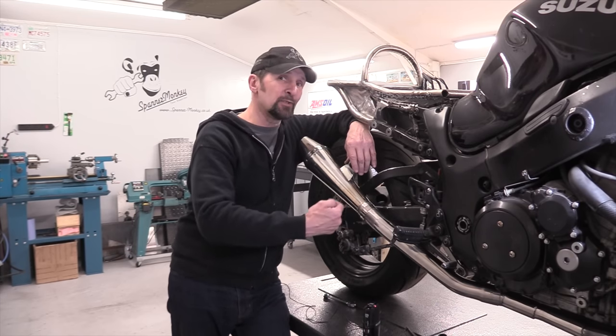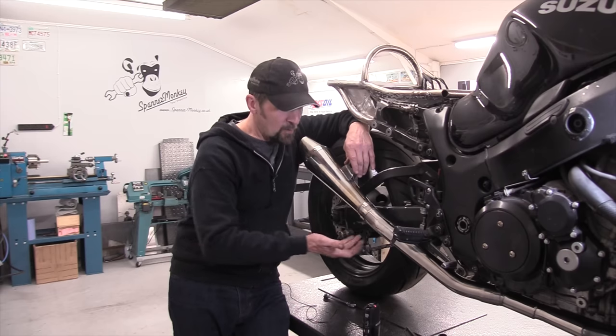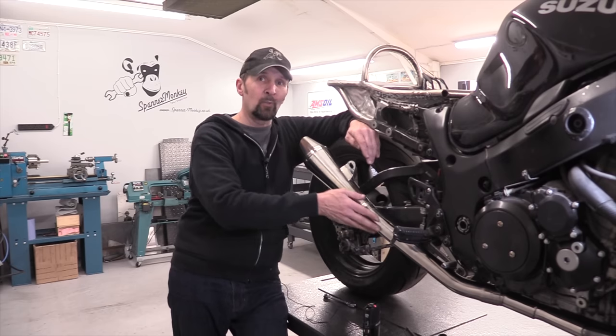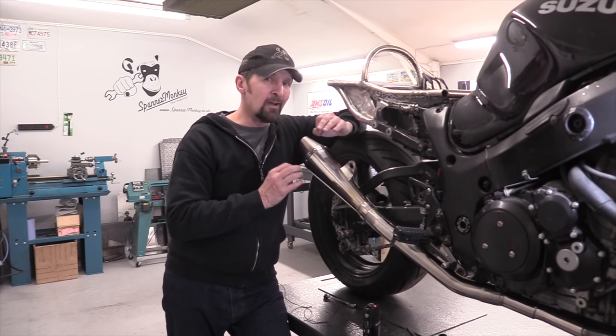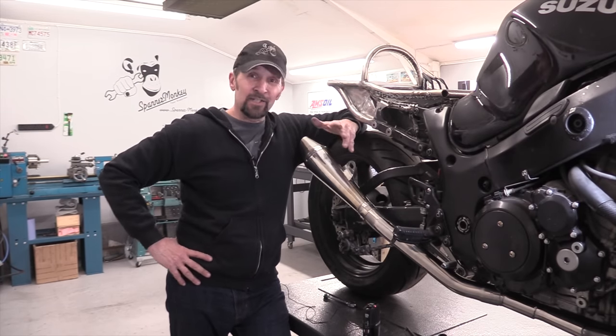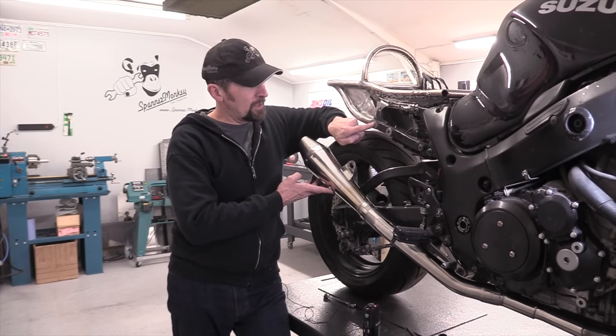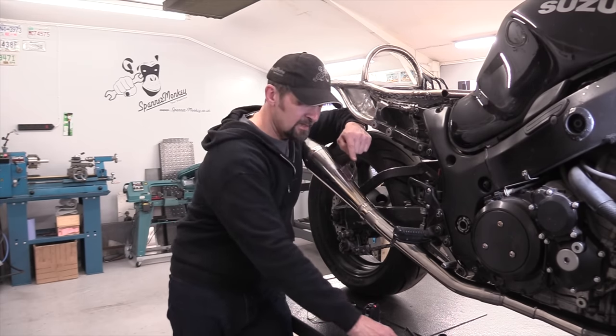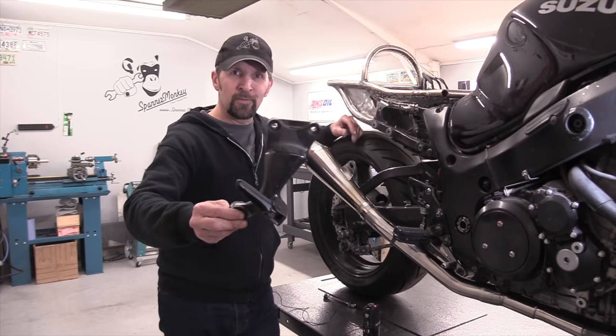So with a little bit of high temperature silicone in there, clamp it down with the bolt on the inside, you'll see nothing, just a silver band at that point, but the pipe itself will be one thickness all the way through. A really nice and subtle looking result. Now that just leaves the hanger. Obviously here I've got 2 points on the frame and a point there, so a 3-point hanger to make in the next video. This is the standard one from the factory.